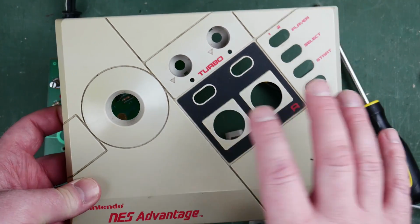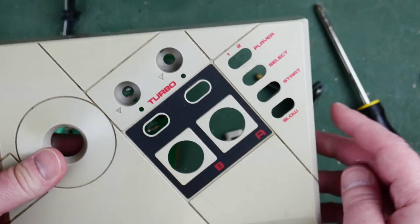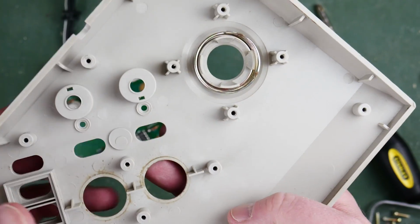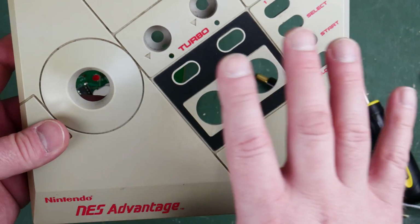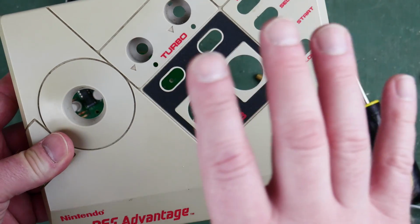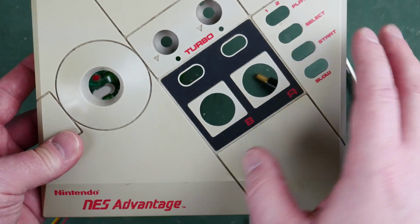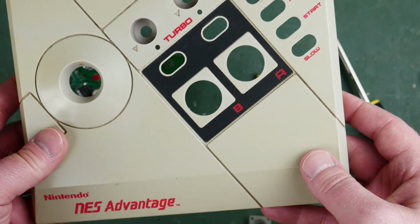And while we've got this connector plate off, we're going to do a little bit of a retrobriting technique on that. You can already see, if you look down in the hole where the dials went, you can see what the plastic used to look like. Same thing on the back side. This is much brighter on the back side than it is on the front side. You can tell all the areas that were exposed. So what we're going to do is submerge this in hydrogen peroxide and then expose it to UV light. We're actually just going to set it outside in a pan, and we'll see after it sits outside for a while.